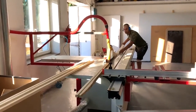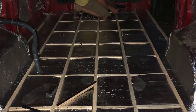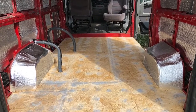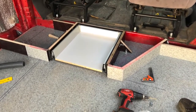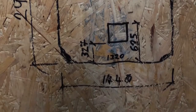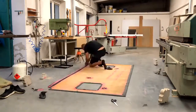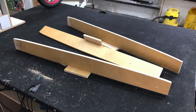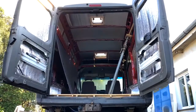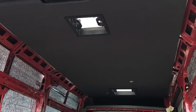Finally we moved to some more interesting parts. There are many ways how to do floors. The way I do it is lifting and evening the floor up and using the same insulation there. For the board itself it's good to use lightened plywood — it's pretty pricey so I just used offcuts from my workshop. On top I contact glued vinyl for commercial use, which is more resistant and difficult to scratch. The roof panel I measured and cut out of 3mm MDF, making sure all cutouts fit and marking holes for lights. I used thick black fabric to make the final result softer and thicker, with a second layer of grey interior fabric. Next I made a few stands out of chipboard that copied the internal roof shape, then installed the panel using PU mammoth glue pushed hard against the roof. The following morning the glue was cured and ready.